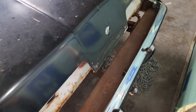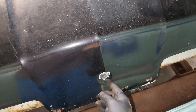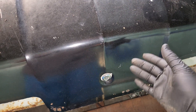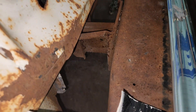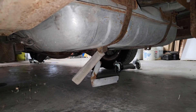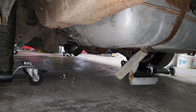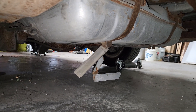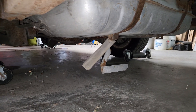Tail lights are gone. I'm gonna have to take out the rear seat back and unbolt the striker, as I don't like to destroy stuff for no reason, so I can get it open and unlatch it from the striker without breaking anything. The bumper mounts are still in good shape so I'm going to claim those. I'll remove the fuel tank — you can buy those. The sending units you can buy too, but we'll see if it's good. I like to keep the little evap plug from up top of these things because sometimes they go rotten and bad.